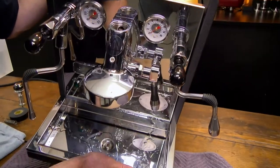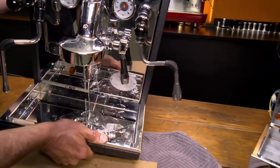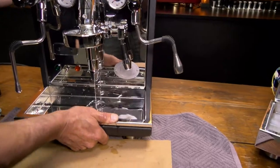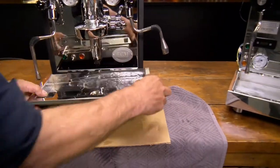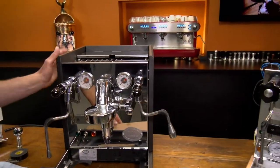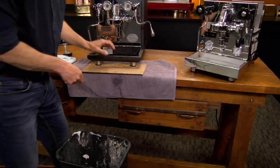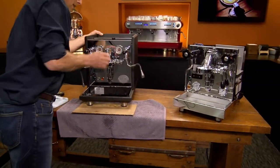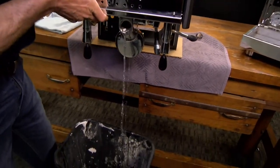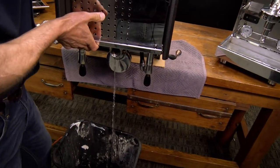Then we'll just put it on an angle a little bit like this to get a little more water out of the boiler and the brew group. Expect a little splashing when you do this — that's why we put a rag down. Now I'll tip the machine forward; I've got to put a bucket down here. Normally you do this over your sink, which works really well, but we don't have that. Hopefully I aligned this up — holding it, I'm guessing about 20 pounds on myself right now.